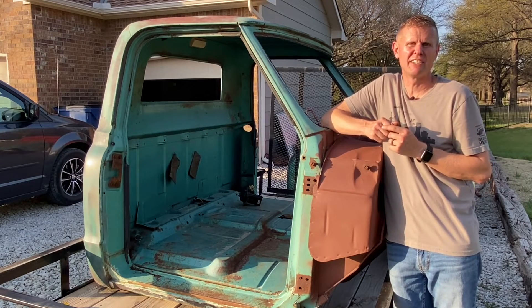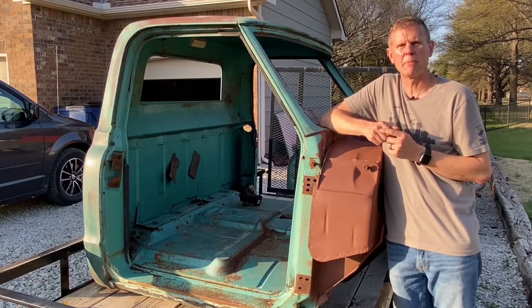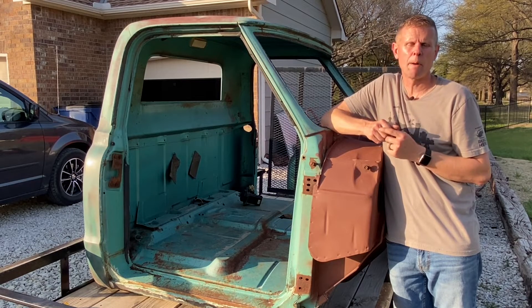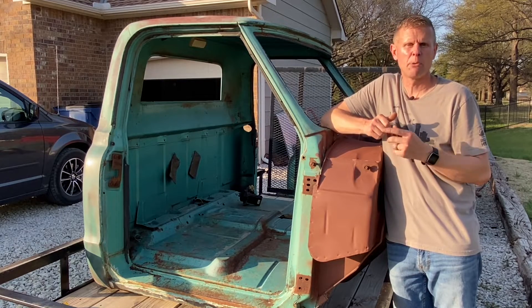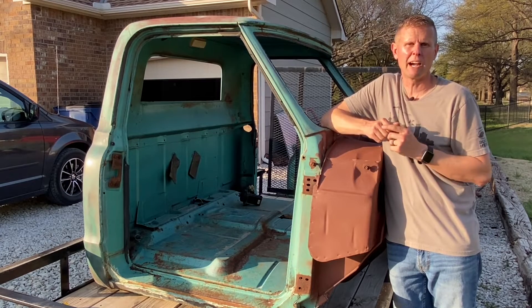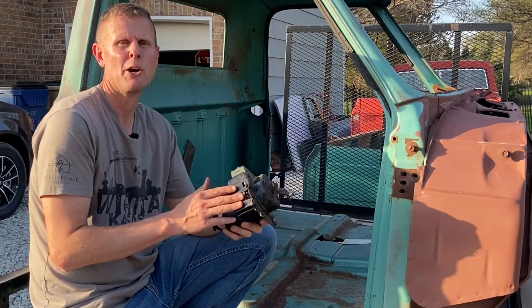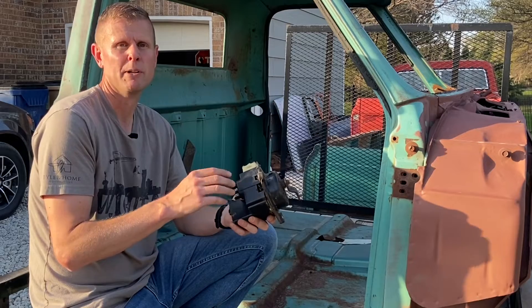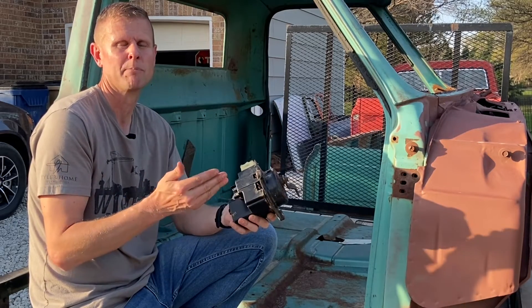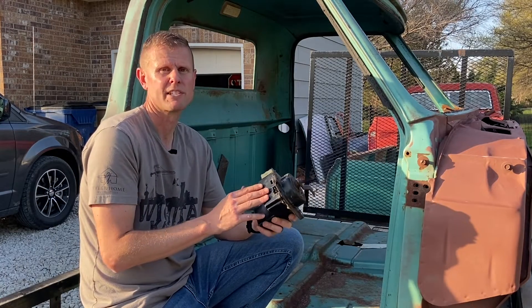I don't know how you'd do it if you actually had a dash in the truck with wires and AC lines and ducts — it'd just be a real bear. Another thing to remember: if you're swapping these motors out, go ahead and swap the pumps as well, but don't forget to prime the pumps. And if you buy an old truck that's been sitting for a long time, just pull all the lines off and blow some fresh air through them — just make sure you don't blow air backwards through the pump where you damage the diaphragm. If you don't want to put a pump back into your old ride, that's no big deal. If you have a new motor that has the pump on it already, just leave it — don't hook the wires up to it, but tape them off so you don't have some type of short, because the yellow wire is hot all the time. If you have a new motor and really want to remove the pump, just remove the whole pump itself and install it the same way you would with just the motor.